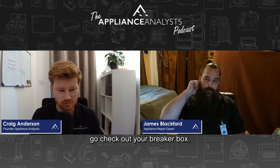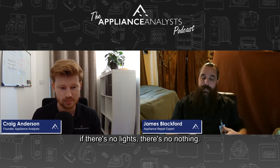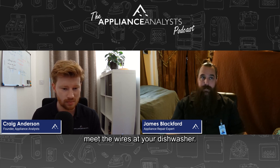If your garbage disposal doesn't come on either, easy fix: go check your breaker box, and it may be as simple as flipping the switch. Now, if your disposal does come on and you confirm you've got power to the dishwasher but there's no lights, the next thing is to turn the breaker off to the dishwasher. You're going to want a meter to make sure you don't have any power to the unit. Remove the access panel in the front on the bottom, and right there at the junction box, remove the screw, typically a 1/4 inch or a 5/16. Then you can check the connections where the wires from your house meet the wires at your dishwasher.